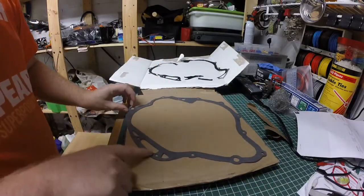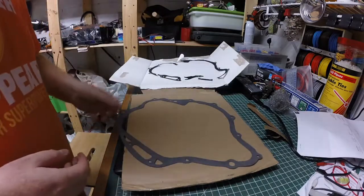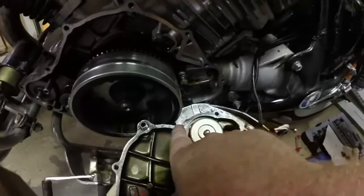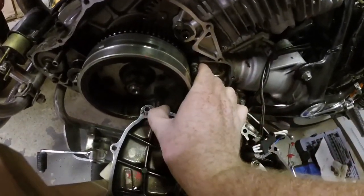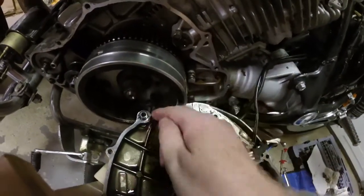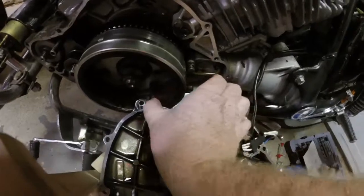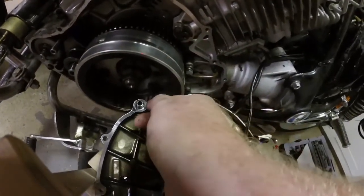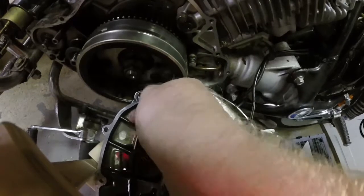It's a little bit thicker, especially around here. A little bit worried about the fit and fitment, but again, the best - or rather the cheapest - eBay can provide. I'm just going over with my finger the whole thing to make sure I've got all the little pieces of remaining gasket. Just using my fingernail to clean it all up. My fingernail is nice and soft against the metal, but hard enough to get rid of gasket leftovers.